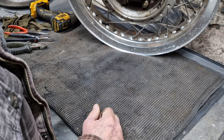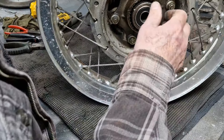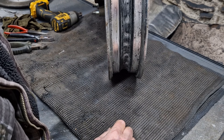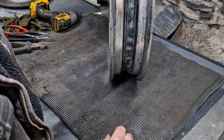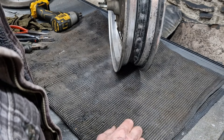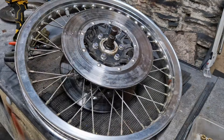This is a tubed rim, so it did have a tube in it. When I took it to the tyre place — Real Motorcycles, as seen earlier on the video — it was full of a green slime, which stops the tube from deflating if it gets a puncture. The green slime comes out and seals the hole, assuming it's not too big — used a lot on pedal bikes. I don't personally like it on motorbikes. What it did on this one was bung up the valve — they couldn't get the air out — so they actually had to drill a hole in the tyre to deflate it and get it off.